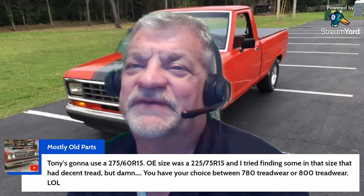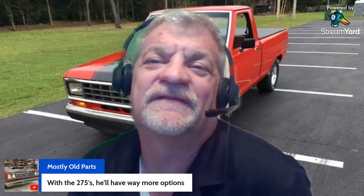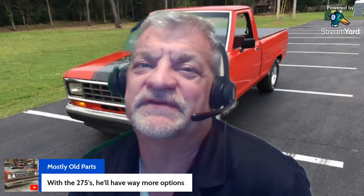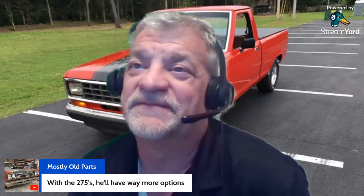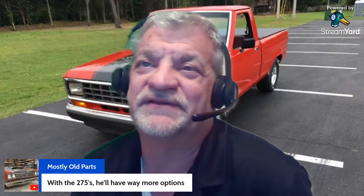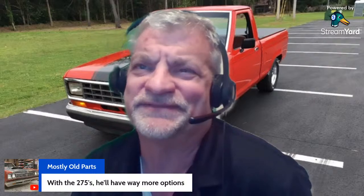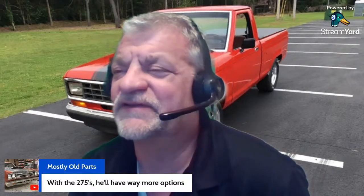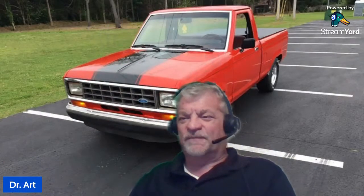Yeah, I would say the 275-60-15 too. With the 275, he'll have way more options. A set of 275s on that, a set of 235-15s would be more than that truck needs for a drag. You put a Nitto drag radial or something like that, not the best high-line drag radials, but for that power level, that's all that truck needs. In my opinion, I could be wrong. I know he wants to keep an OE style looking tire on there, but everybody's got their own view on how everything should happen.